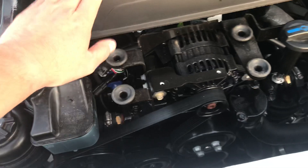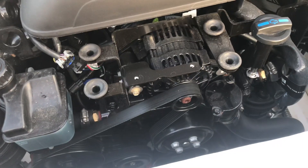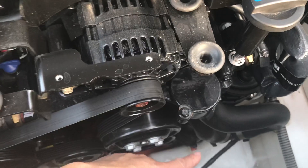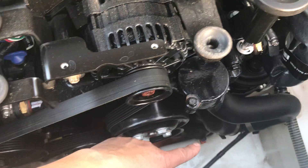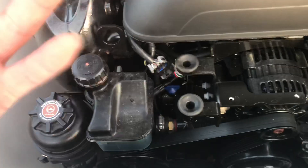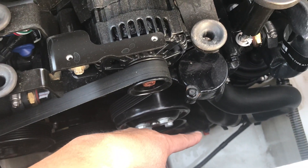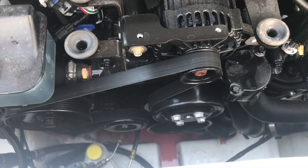I then released all the water from the engine using the single point release. I opened this up and let the water from that orange nozzle there come out. Once it comes out for about 30 seconds, I opened this other blue valve here to let some air in so that it drains down even further. I also opened that blue water housing plug as well, then let all the water drain out for approximately five to ten minutes.